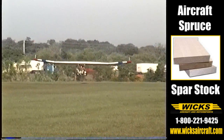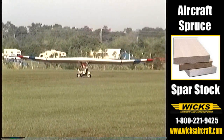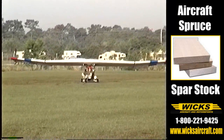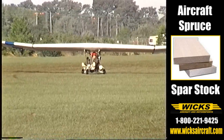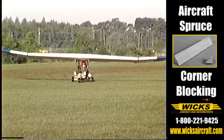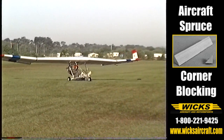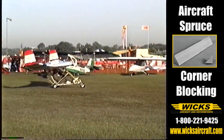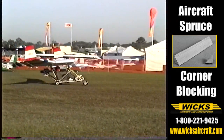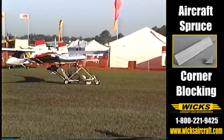What would this engine retail for, and what kind of horsepower is it putting out? According to the engine specs, at low-end power it's making 26 horsepower, and at higher end it's making 32 horsepower. As for thrust, it's about 80 pounds of thrust at the top end. It weighs 53 pounds, and in fact this engine installation weighs the same as the Zenoa with the drive assembly.